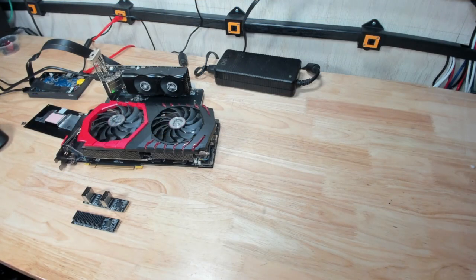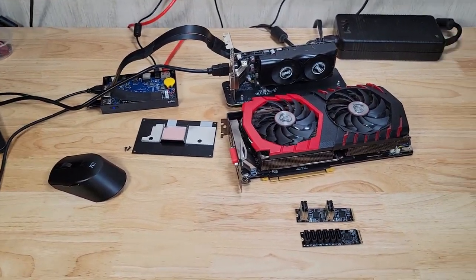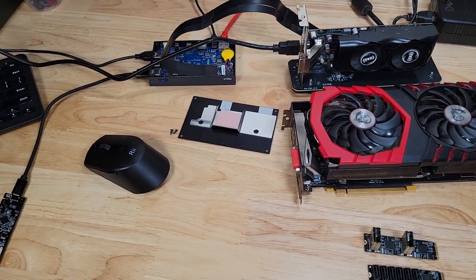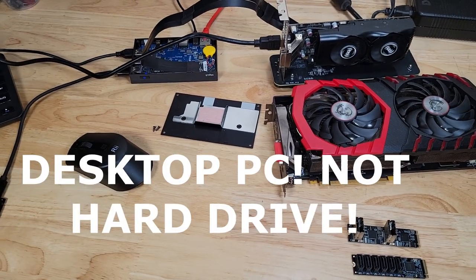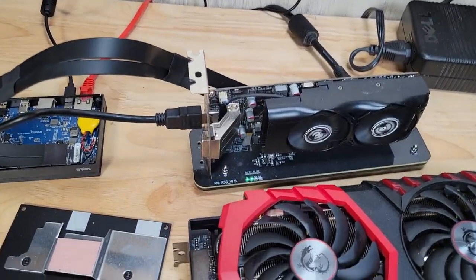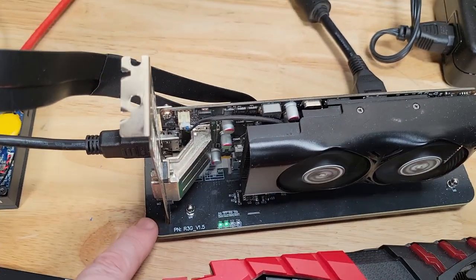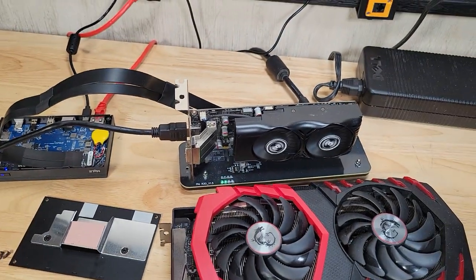Okay, so that about wraps it up for now. But before I go, I'd like to show you what you can do with a device like this. Because when they start adding things like M.2 slots, those are actually PCIe slots, just like you'd find on a desktop. You can get adapters, so you can run things like, let me show you here. Here I've got an adapter, M.2 PCIe, over to this full-size 16x PCIe 3.0 slot. So I can actually run a graphics card in here.